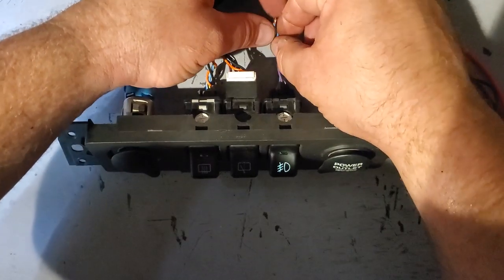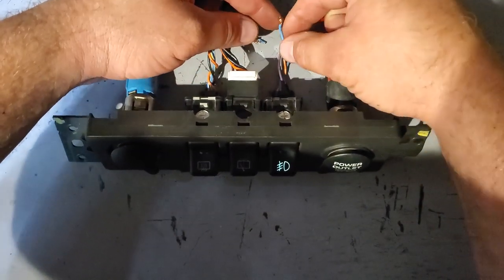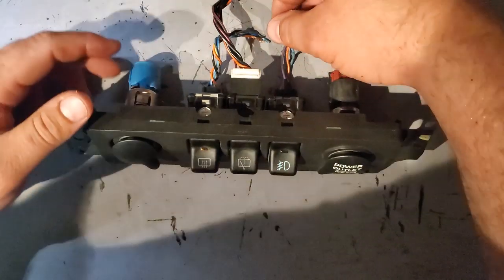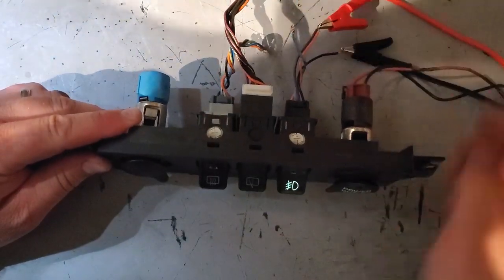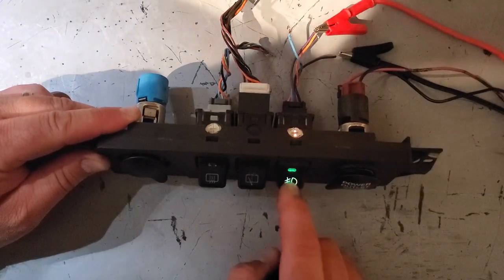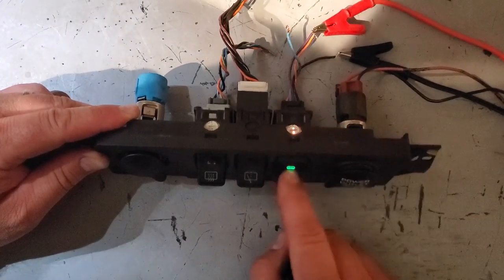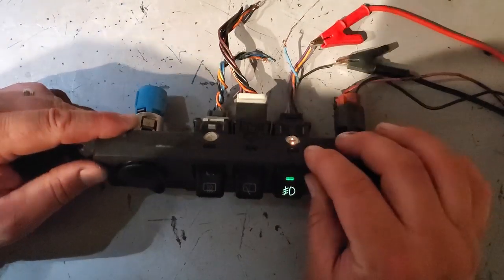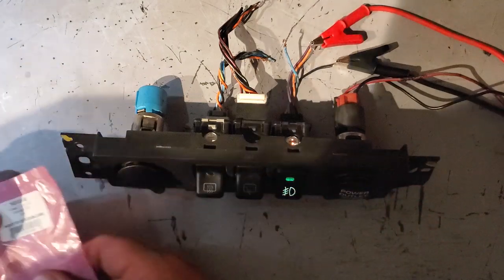Now, when you flick the switch, it sends the signal to your relay from the blue. So the blue is the switch output. So here we go. We're going to throw this switch, and boom, that indicator light goes on. And this indicator light is the culprit. That's what burns out these switches. Let me show you what you can put in there in its place.